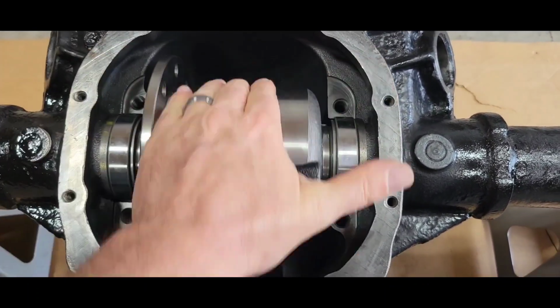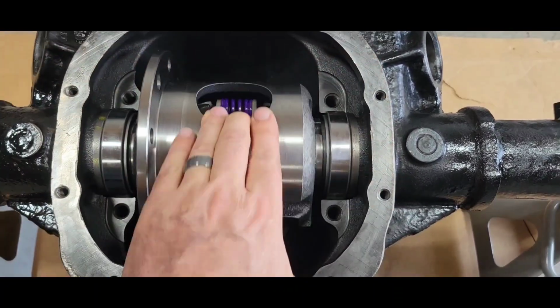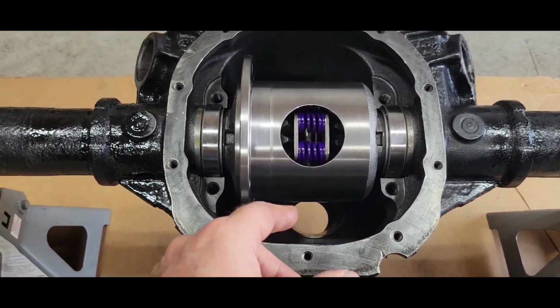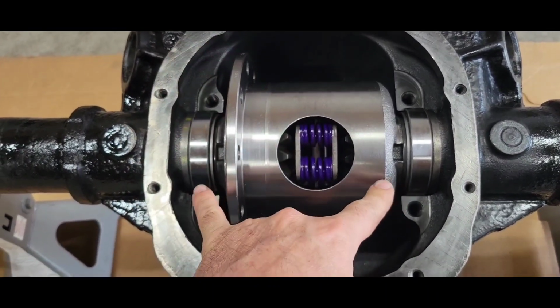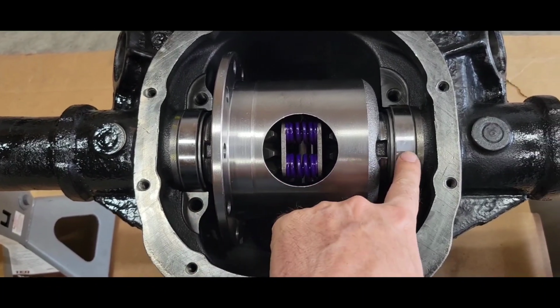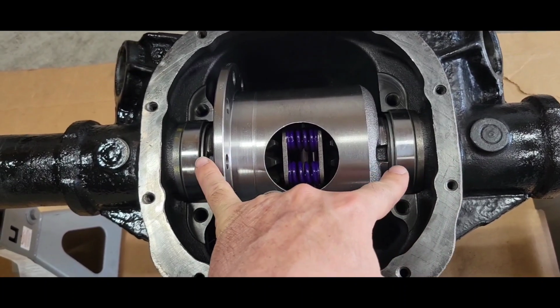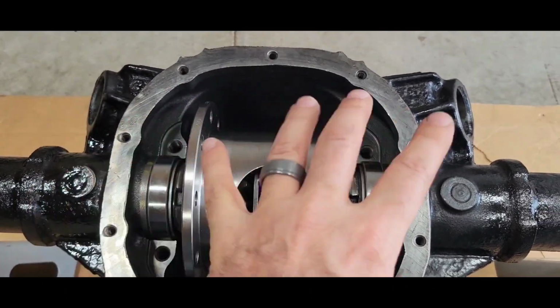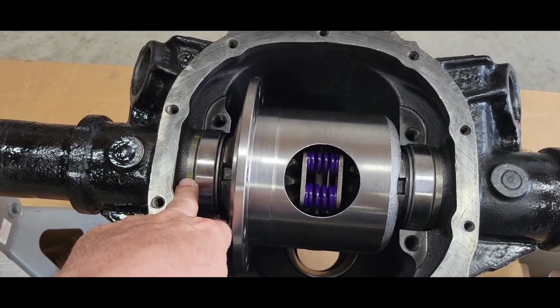You know, it's there. I almost want to let that go, but I want to check my backlash with my mock-up bearings. So I'm going to go ahead and put the gear on, and I want to see my backlash because I can't do anything right now. I can't pull nothing out, shift nothing over. If that's my preload, that's my preload. I got to use the sum of both of those shims added together. That's the preload. I can't change that amount. I can shift from one side to the other, but there's nothing to take out.